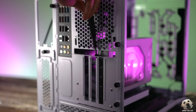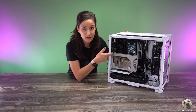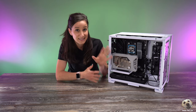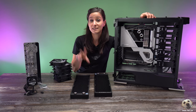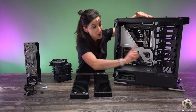Now we just have to screw it in. When mounting the GPU I realized that the rear fan was in the way, so I had to remove it in order to get the GPU in place — something to keep in mind. The other thing: because the GPU is so silver I'm considering possibly painting these radiators now that I see it all together, which would mean I'd have to take everything out. But for now, this is where we leave it and we're going to jump to our Phanteks case.